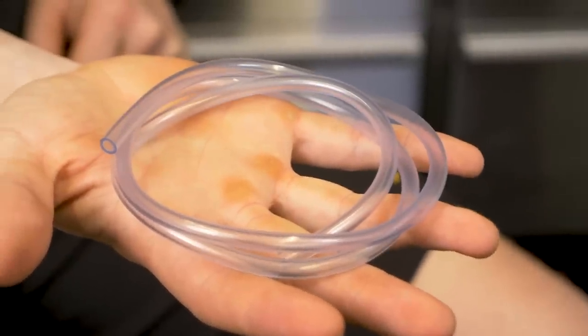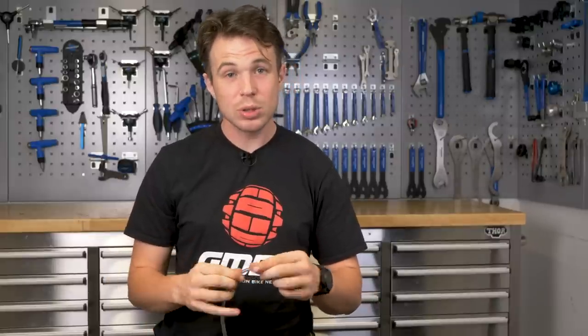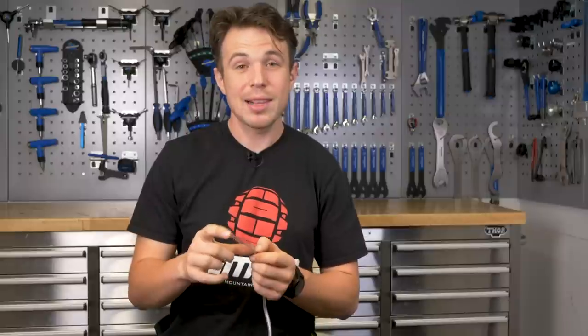This transparent — I think it's just some water hose — is really good for protecting your cables when they are outside of the frame. If your cables go beneath the bottom bracket, they can be really vulnerable to rock strikes. It's also very good when you loop it and it goes around to the derailleur — this can actually stop it vibrating on the frame, and it's a lot softer than the hard metal encased in plastic that makes up an outer cable. You can cut it to length — an inch or two long — and it's really good for running either side of a head tube or seat tube, keeping cables secure even though they're further away. People on race bikes might have a length of this to keep their front brake hose off their number board, just to stop it vibrating, because it can be really noisy especially when you're going at speed.